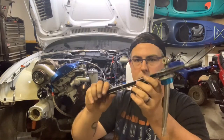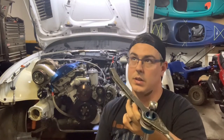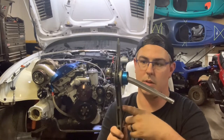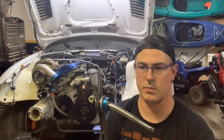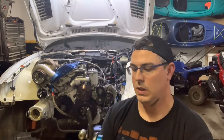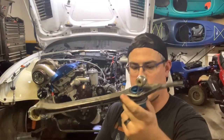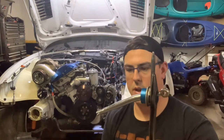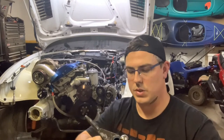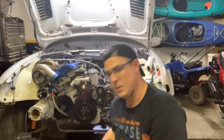This is the carrier you need if you don't have solid mounts and you still want a floor shifter with a short throw — that's the only way to get a shifter that's actually stable with rubber mounts. As you can tell it's super dirty and crusty; this one definitely should have gotten more life out of it before getting this sloppy. But for $37 you can just buy another one and slap it in on a weekend — there's literally one clip.